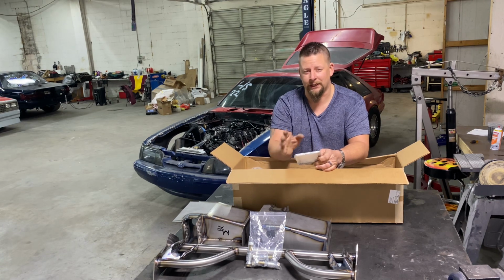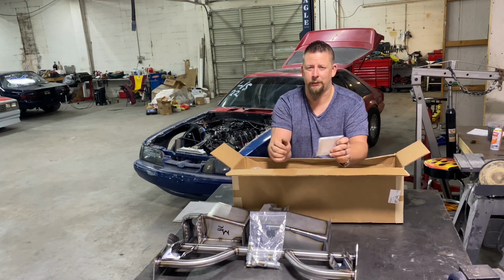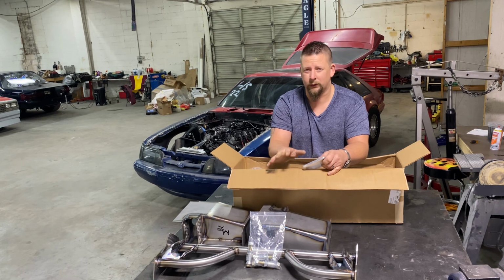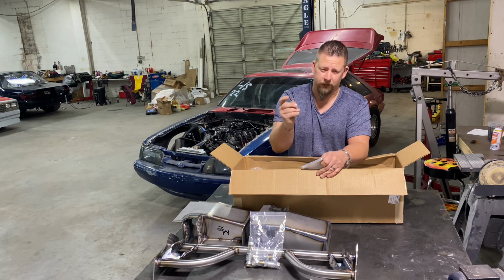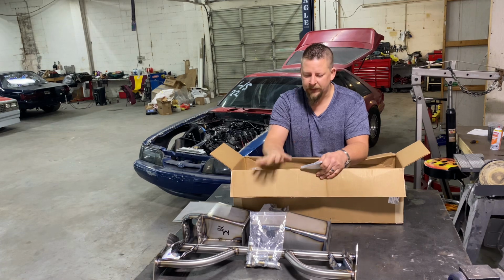Once you get your old ones out, clean up the face of the frame rail, you just shove that torque box in there up against the floor pan, align those notches in the frame rail, and weld it up. The lower torque boxes are about the same. When you cut them out, he's got everything configured to where it fits around the frame rail up against the car, and you weld those things down the frame rail, around the floor pan, and they're in there.